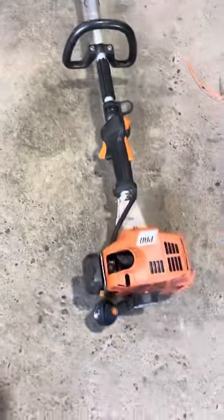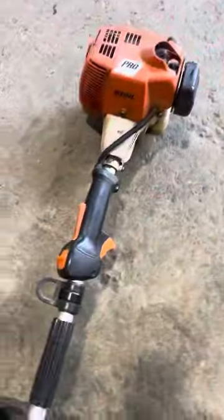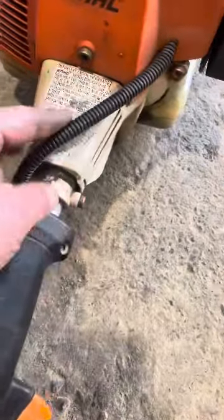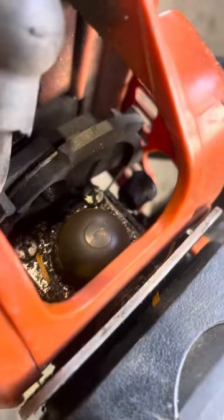So let me take a look here. It's sitting upright — notice how this handle's a bit twisted. Well, your throttle cable runs from this handle right to the motor, so you can see there's actually some stress and tension on here, just causing the throttle to be held wide open inside there.